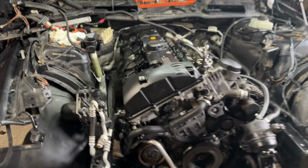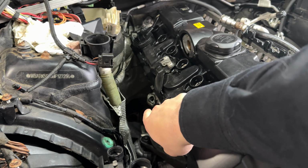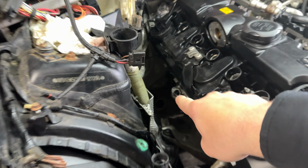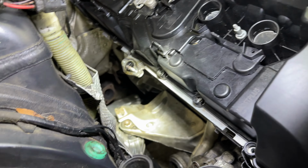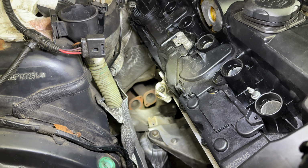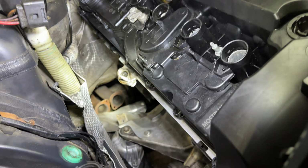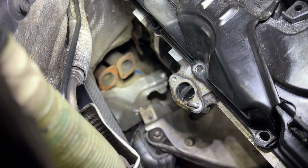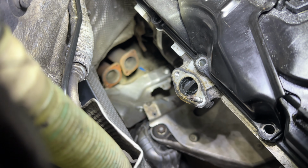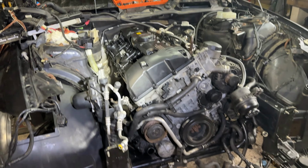Additionally, what also sucked was trying to get the headers to fit onto the existing exhaust down in that hole. Where the headers collect and go down, they're obviously gonna mate with the pre-existing exhaust. But what makes it difficult is that there's only a little bit of room to get the pipes to follow the path to mate up with the pre-existing exhaust. So that's also another thing, that the subframe will get in the way while you're trying to work on this.